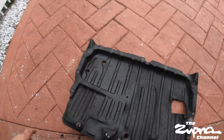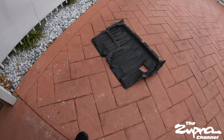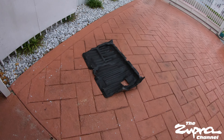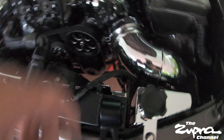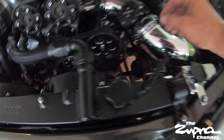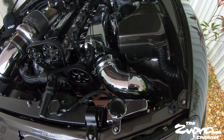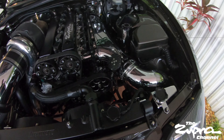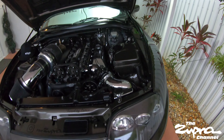You can see how hot it is just taking out the belly pan. You can see all the oil on this side and the water coming down — I think that meet's going to be a no-go. I'm going to put some degreaser on there and clean all that grease and ATF off the power steering area. I'll start on this line and I might have to take off the charge pipe just to get more clearance.